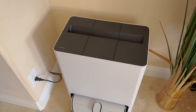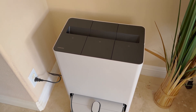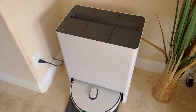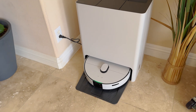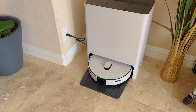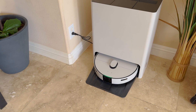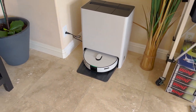If your water tank is not being detected, it's probably because that magnet fell out. Either contact Samsung if you've lost it, or find the magnet and shove it back in. Maybe a little glue gun to keep it from falling out would be a design improvement. Let's take a look at the robot in action and see how it does mopping as well as navigating between tile and carpet. I'll set it to clean through the app.